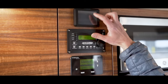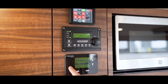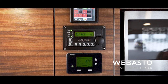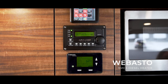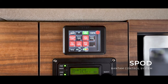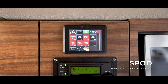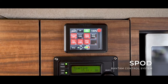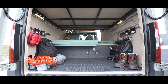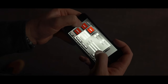The control panel is located in a centralized location giving control access to all the systems in the van. This panel features a digital Webasto cabin and water heating controller along with the inverter controller. Above that is the S-Pod Bantam control system, which displays voltage feedback from the vehicle's battery and alternator and gives an amperage reading to show the current draw of each appliance. The S-Pod also gives you control of your water pump for the 20 gallon water tank, external and internal light control, and can be programmed to add additional components down the road.